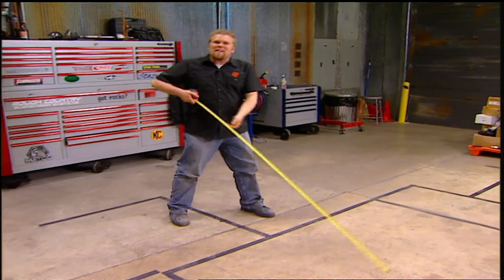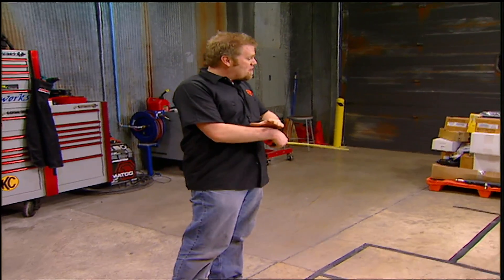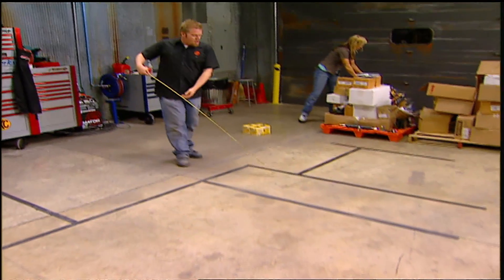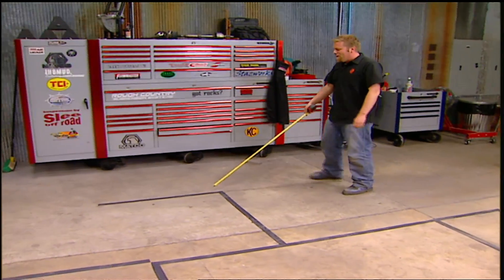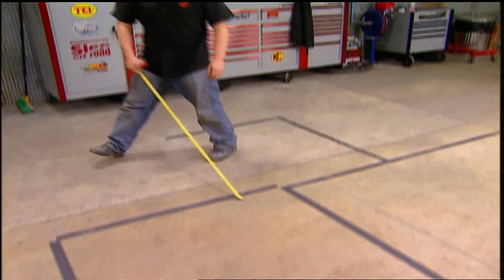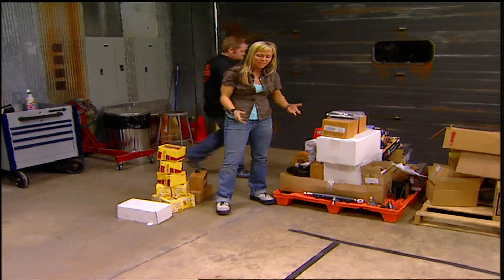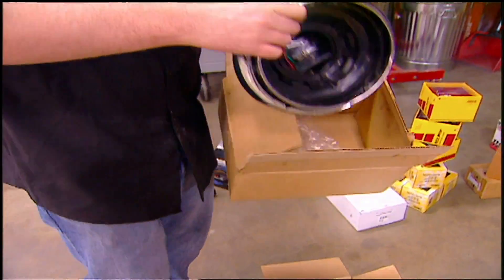The inside of the Gorilla is pretty big, and today we're going to be taking care of the wiring harness. A great way to do that is to lay everything out on the floor. We simply measured the truck — this big box is the floor, this little rectangle up here is basically the firewall. We'll have one wiring harness feed to run our headlights in front, a piece that runs up the B pillar and out the roof to the off-road lights, back to the center for dome lights, and a feed out to the back to run both tail lights. By laying everything out and building your harness this way, you won't have to be crawling all over the truck bumping your head. With this many parts, a plan of attack is an absolute necessity.